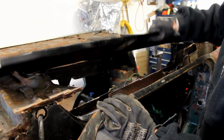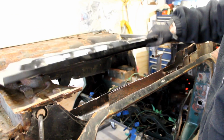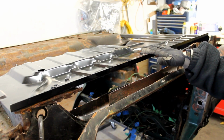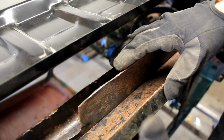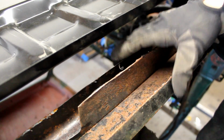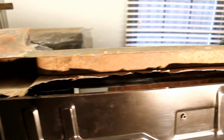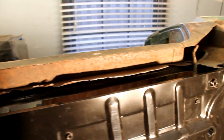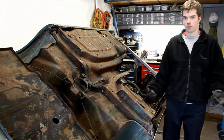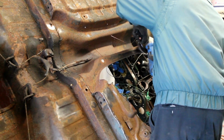You'll notice that without the floor pan, we have no pinch weld anymore. So by installing this, now we have something to work back up to again. You will have also noticed that we left a small portion of the top of the door sill in order to retain the same door gap. If we remove this bit, there is a high possibility that the shell could warp and mess up all the panel gaps. Having left the original metal in place means that we should hopefully have avoided this issue. So for the first of what will undoubtedly be many times, let's get the angle grinder out.